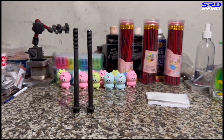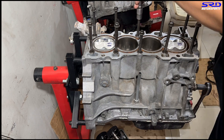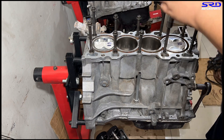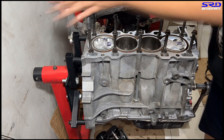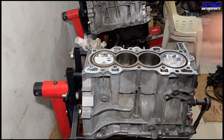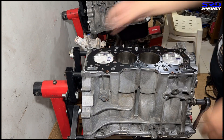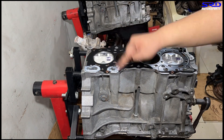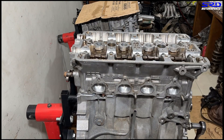Now on the engine stand, we pre-lubricated the head studs and tightened them onto the block, since the block was cleaned thoroughly and all the threads are dry. This way the studs get ARP fastener lube on the threads and work more consistently. We remove them, make sure the deck is clean, wipe it off, and then put Honda Bond on the drain corners — this is optional but we always do it when there's potential for leaking or seeping, which is why our builds don't leak between the head and block.